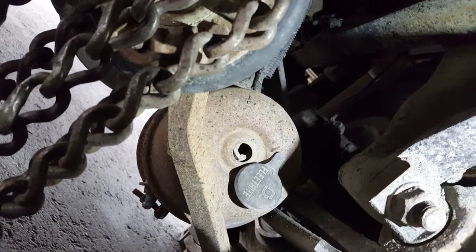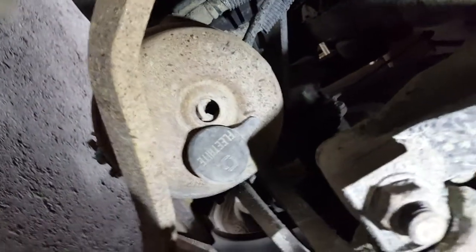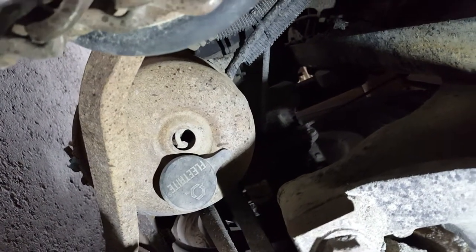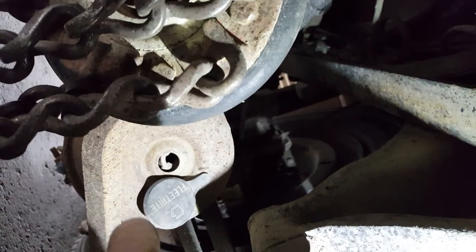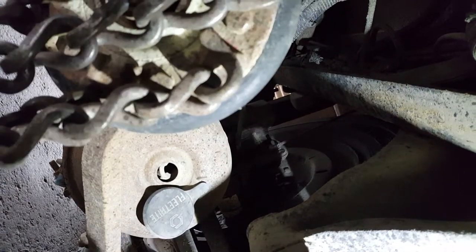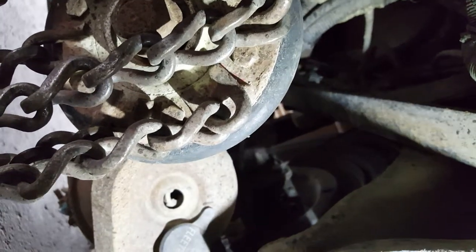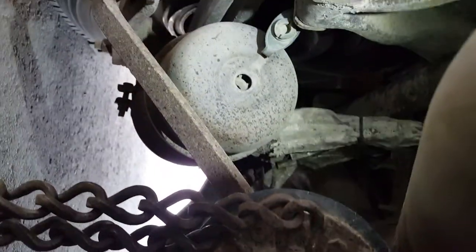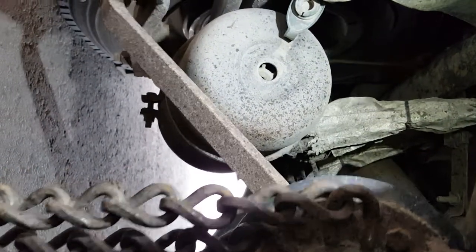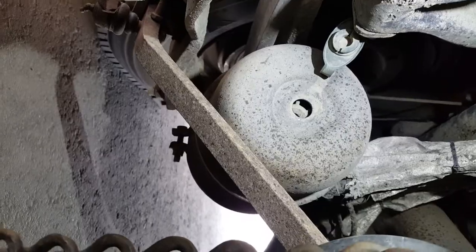So this is the driver's side maxi pot. One sign is that the caging part of the pot isn't centered in the hole — it's not lined up very well. That's not a good sign. And this one's the same, it's way off. So the spring is not centered.